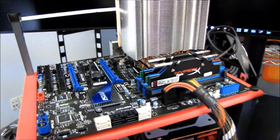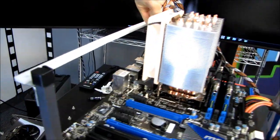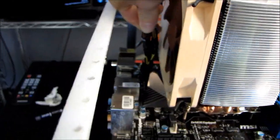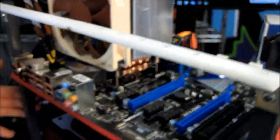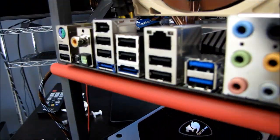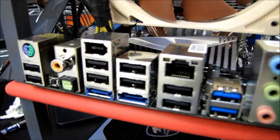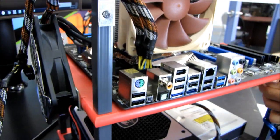I'm going to plug in my four-pin CPU connector. The 24-pin and 4-pin connections haven't changed at all. At the back we have some new slots — instead of running only two USB 3.0 ports on the back panel, we now have two on the back panel and two on an internal header.